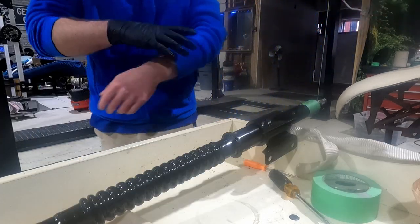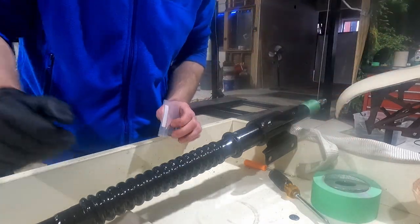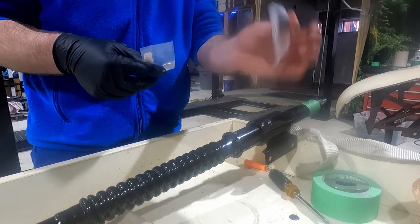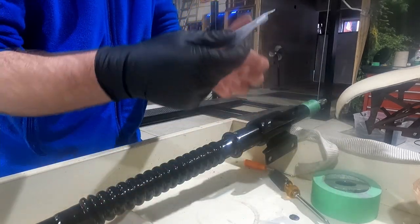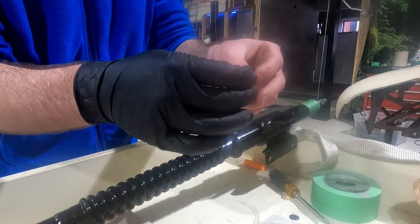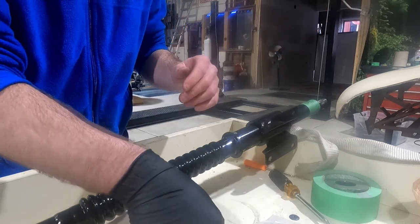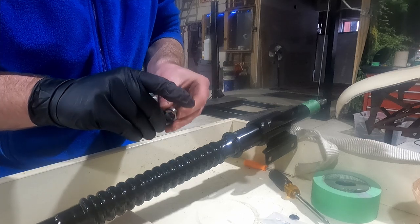For the top of the steering column where you just bolt your steering wheel in, OEM steering wheel nut, lock washer, and new OEM steering wheel collets. Definitely if you take this off, make sure you don't rip this apart, lose the band spring. Don't know how you'd find a new one. So my collet didn't have a lot of grease on it.